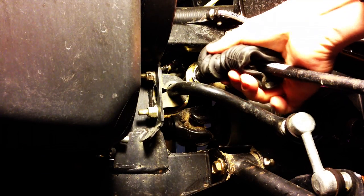To gain access to the other end of the tie rod, we'll need to remove the rubber boot, first by undoing the plastic band. Next we'll clip the plastic zip tie that secures the rubber boot to the steering rack itself.